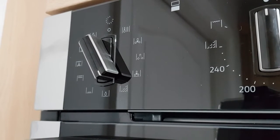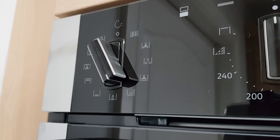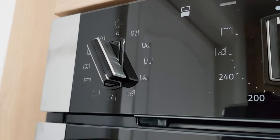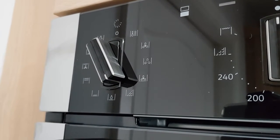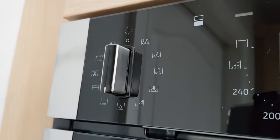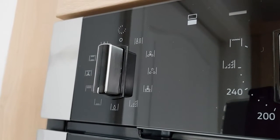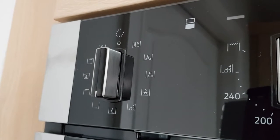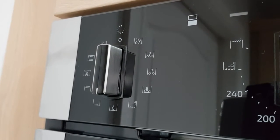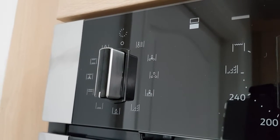The next option is the eco clean function. When you turn it on, it burns away any stubborn food left inside your oven by heating it to maximum temperature for around an hour, oxidizing any residual food. Once complete, you just wait for it to cool down, go in with a soapy cloth, and wipe down the surfaces. The bottom cleaning function works differently — you add a little water plus washing-up liquid to the bottom of the oven, then this function runs for around 21 minutes, gently heating and vaporizing the water so all surfaces become easily cleanable. Any residual water left after this process should be removed rather than left to vaporize.